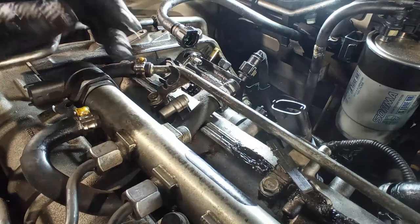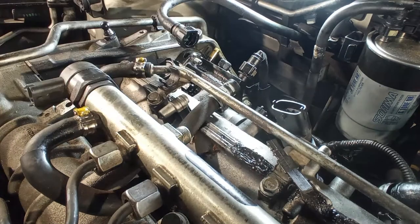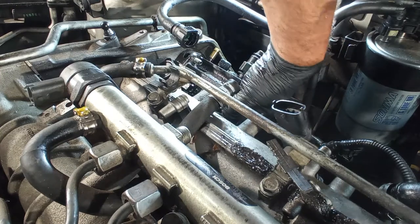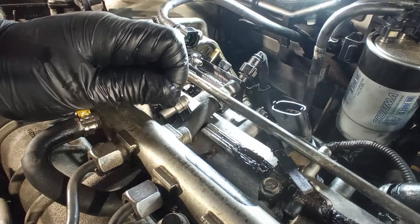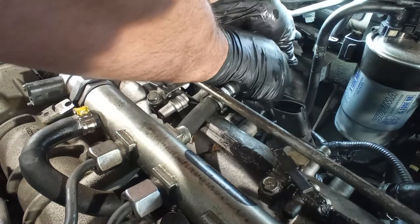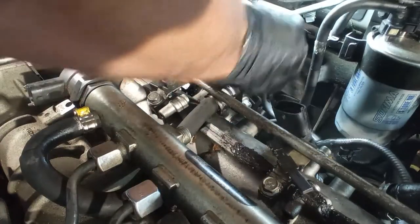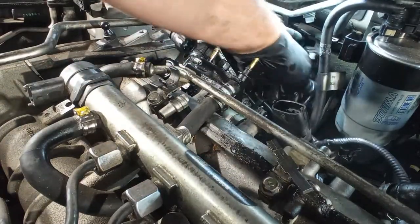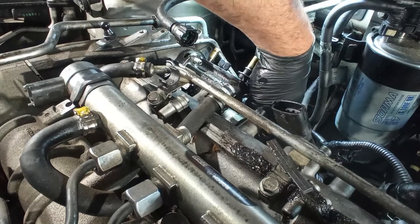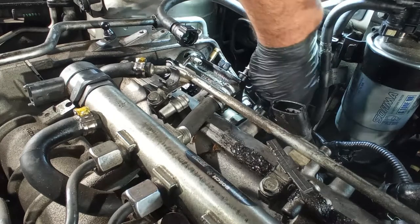This nut is not from here. Actually, this has to use 12 millimeter nuts, not 13, and it has to be self-locking ones. So for this, I have two more nuts, as you can remember, and I do not know if they are 12 or 13, so I have to pick a little bit to find out, but I think they are 13. Another 13. I have to put new or good used nuts over here, because this can back up with vibration.